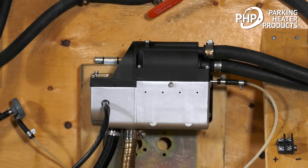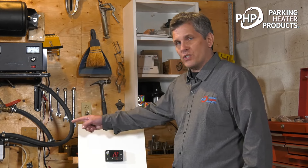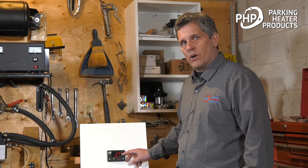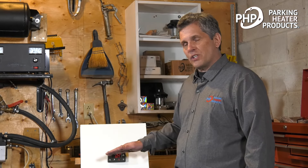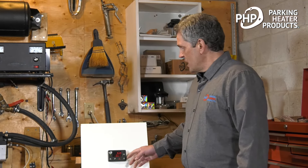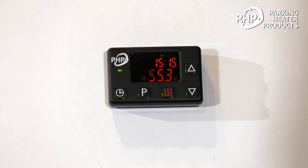Once the blower is switched on, the heater runs in high heat mode and monitors temperature via an integrated sensor — currently showing 59 degrees Celsius incoming. The heater runs in high heat mode until the temperature reaches 70°C, at which point it switches into low heat mode: the fuel pump pulses slow and the blower motor slows. If the temperature continues to rise and reaches 75°C, the heater switches off and goes through a cooldown. If the temperature drops below 65°C while running in low, it kicks back up to high. If the heater reaches 75°C and shuts down, it won't restart until the temperature drops to 55°C.